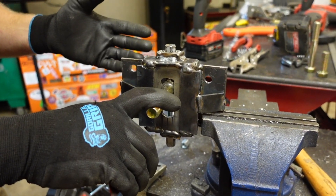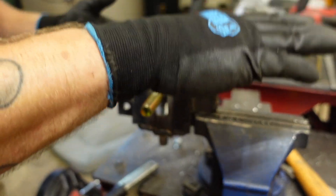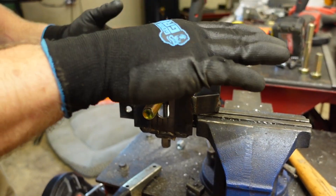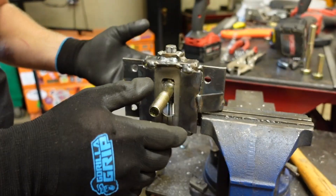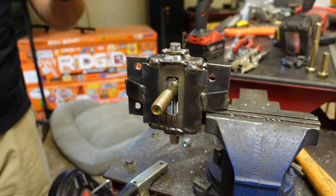So that the tensioner arm will be down more. Even after the belt breaks in and stretches, it'll always just be under spring tension. It won't be able to max out and touch anything. The reason I went this route with this adjustable idler pulley setup is because I did not want to remake another tensioner pulley arm - that thing is a done deal. I want to leave it alone, so I want to take up more slack.